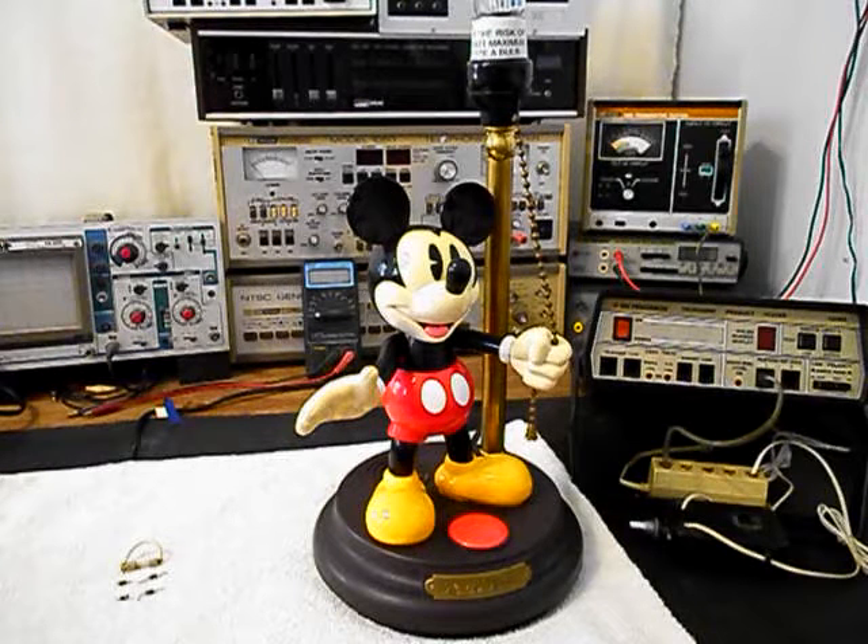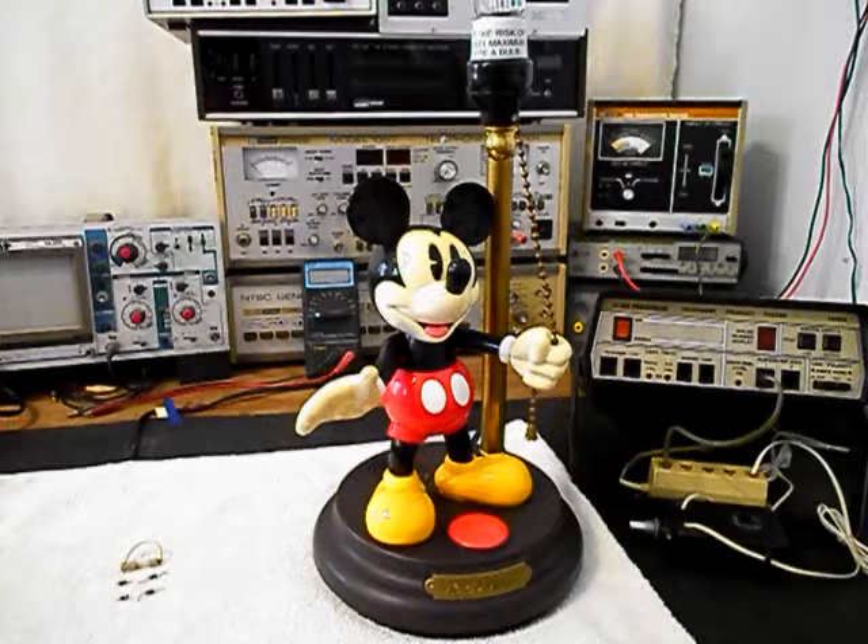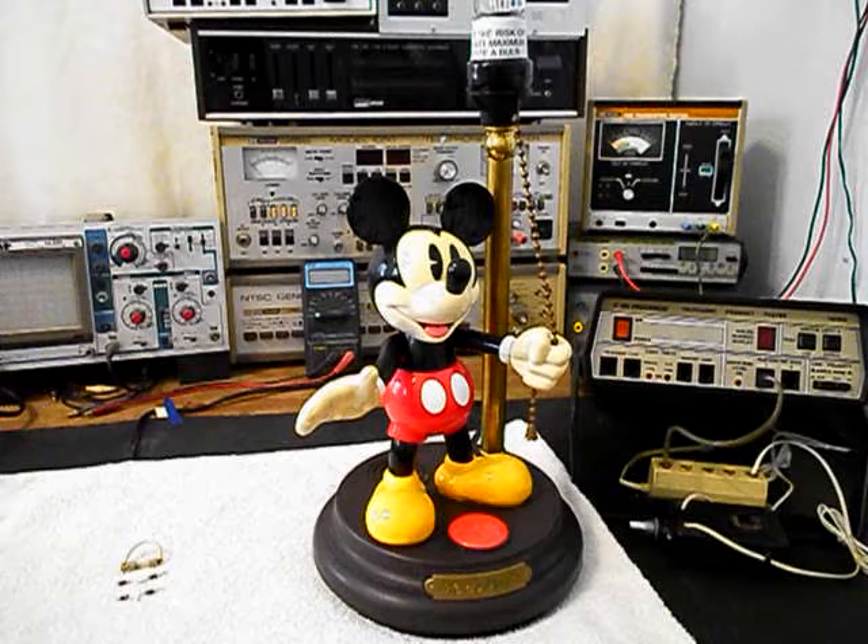We also want to mention that there's a tag on the socket for the light bulb of Mickey, talking about how you can use up to a 75-watt bulb. I would not use a 75-watt bulb in this unit — around a 40-watt, because the lampshades are pretty delicate and you don't want to bleach out any parts of Mickey. The plastic is prone to bleaching out with too high a wattage. Also, when plugging in and unplugging Mickey from an electrical outlet, you always want to use the off-and-on switch at the back of the base. The electronics associated with this type of lamp are pretty delicate and prone to power surges.